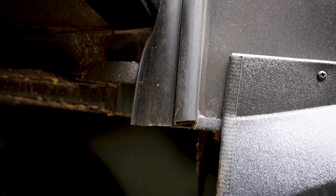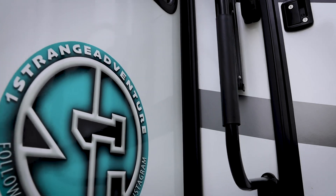Next on the list is the seams and the sealant. You want to walk around the RV, inspect all of the seals, get up on the roof, and look at all those seams. If you see any cracking, you may want to address that. In addition to that, I like to condition the rubber seals that go around the slide-outs to make sure that they are working properly and providing a nice tight seal for when we go camping.